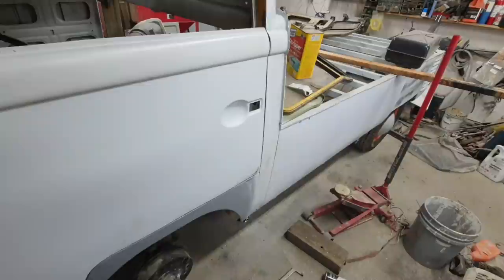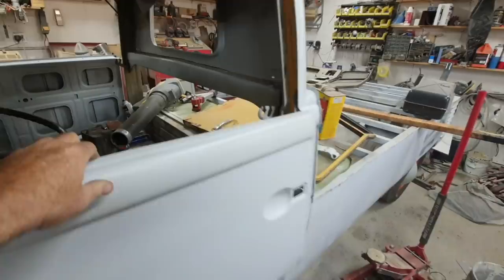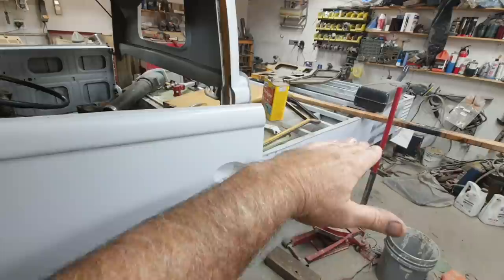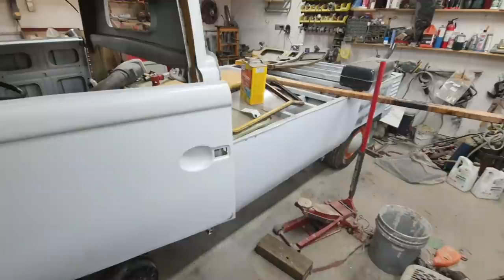It's partly the door, but it's also partly the cab. Like I said, there's basically a giant rust hole all the way around this whole area and all the way down to the frame. They had jacked it up and put this temporary frame rail underneath and over corrected it. It was probably hanging down, like 6 inches or something, before they put that frame rail in there, I don't know, to get it transported over here. So literally this truck was not savable.